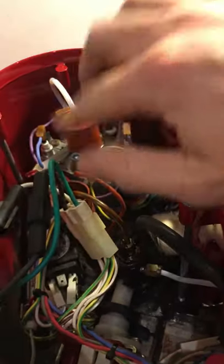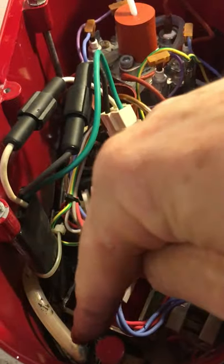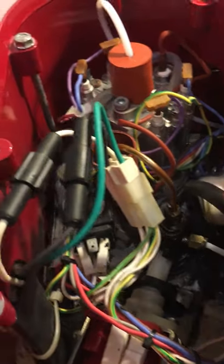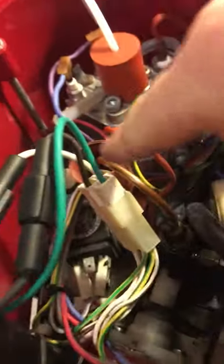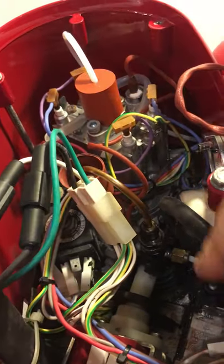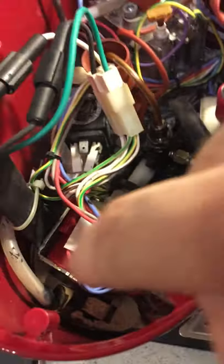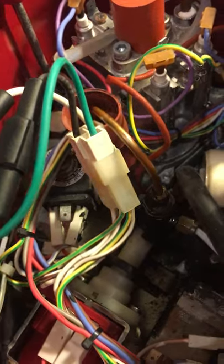On this system you've got one boiler on this side which powers the steam unit, and under here is another boiler. It draws the water up through the pump, through this line here, and distributes it — one line goes through into the second steamer boiler. Mine was just leaking down here, flooding the main deck, which caused an electrical issue — that's where the smoke came from.